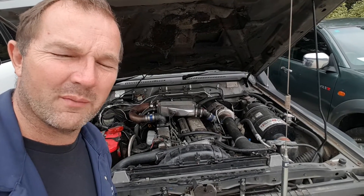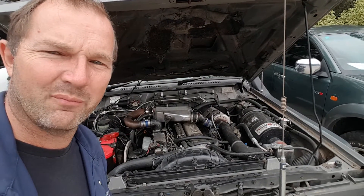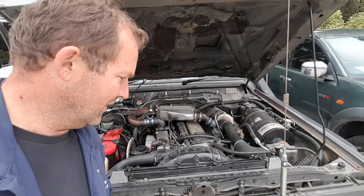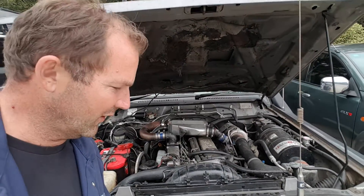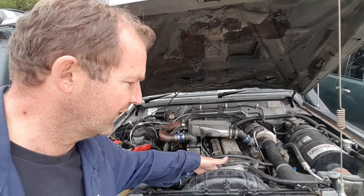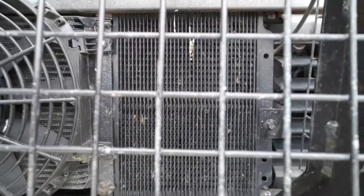You really do have to remember when you're putting accessories on the front of vehicles — whether it be lights or all sorts of other things — there's certainly plenty of vehicles that don't have problems, but sometimes the accessories go a bit overboard. Whatever these things are doing on the front, they're probably related to the water-to-air intercooler, and they're highly restrictive. The poor old cooling fan — if I have a feel of it, it's fairly solid, so it's probably driving — but there's just no way air's getting in through the front here.